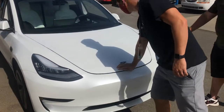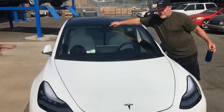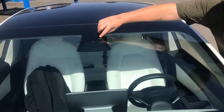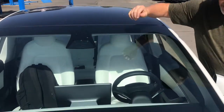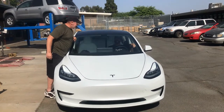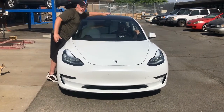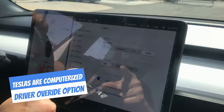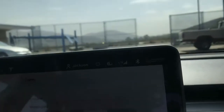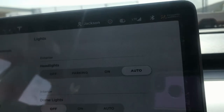Regarding headlights — we would normally check them, but there's a sun sensor on this Tesla, probably located up here as this small dot. That sun sensor dictates when the lights come on, and right now we're in full sun so it won't turn the headlights on automatically. I covered the sun sensor and the headlights turned on, then removed my hand and they turned off. You can also manually turn them on here and they'll work even with the light sensor active. I'll keep it on auto.